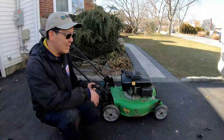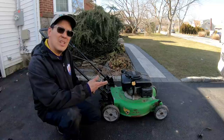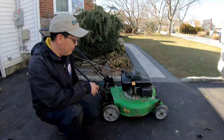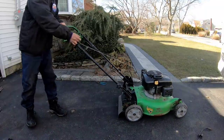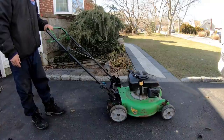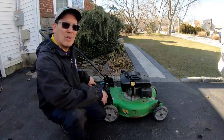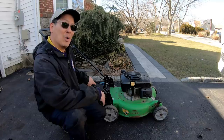I'm trying to fix it again, but either way, finding this on the street, thanks to Frank the UPS guy, I replaced the primer assembly for the auto choke, which was filled with water. Pushed out all the water, didn't do a carb clean, seems to run just fine. Fixed the bale handle cable and the engagement handle cable for the drive. Seems to run pretty well, but I'll mess with the drive cable a little bit more, see why the belt keeps slipping off. Other than that, I think the gearbox works, so we'll figure that out tomorrow.